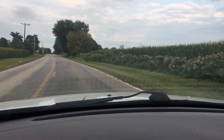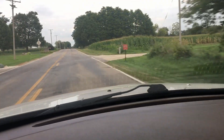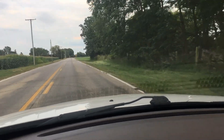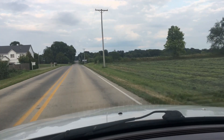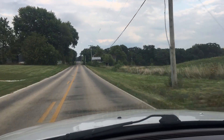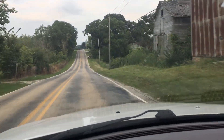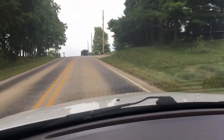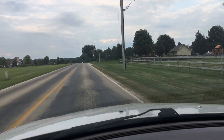But this one is just all over the place. Whenever you have that kind of concern, you've got to look real close at anything that may be loose or coming apart, but in general you want to look at the shocks and springs more than anything. Here are some imperfections - some hills - and it's just that overall sense that you don't have much control of the vehicle. You're getting thrown around a little bit, it's just not solid and planted in the road. We'll go to the shop and check this one out.